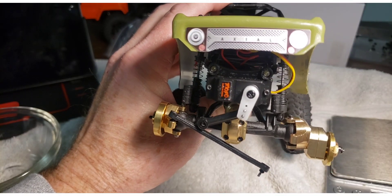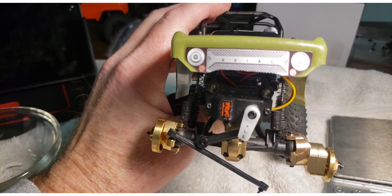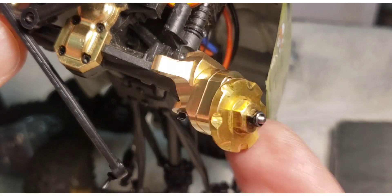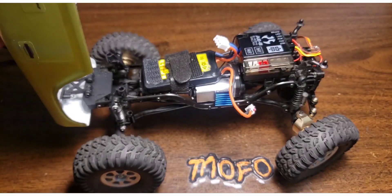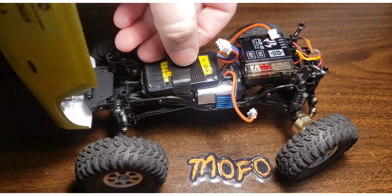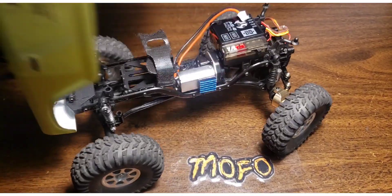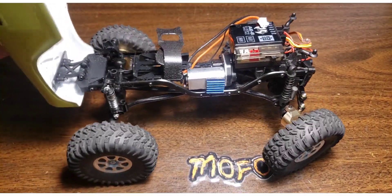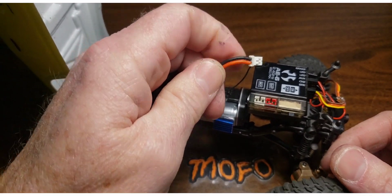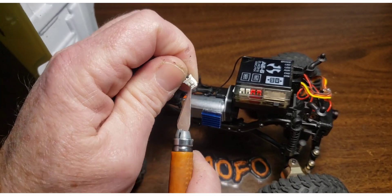There's a side-by-side comparison — quite a bit wider on the driver's side. Anytime you're putting steering knuckles together, make sure they have free movement; if they don't, you're going to burn out steering servos. Now with it put together, the only thing left to do is change the polarity of the motor wire. I'm going to remove the battery first because I don't want to accidentally swap the wrong wires. I'll just swap the plugs around with a razor blade — get underneath the catches on the little plug.